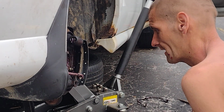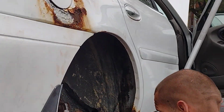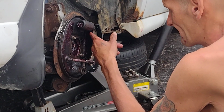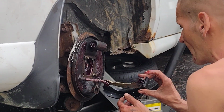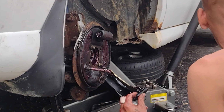Kayak. All right, we're back. I had a hell of a time getting this emergency brake cable on, because it has a lot of tension on some of these arms, here riveted. I didn't know this was not. There's a clip in the back of this that you have to pry off. I'd go that route over pulling a whole cable off. But if they're riveted, you're screwed.